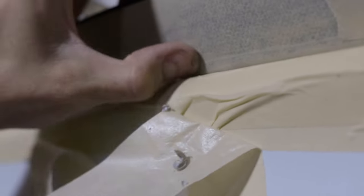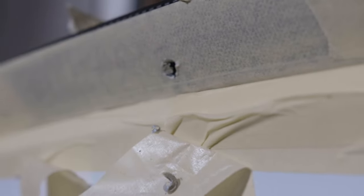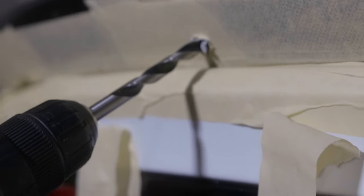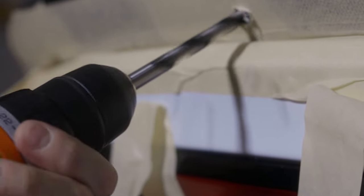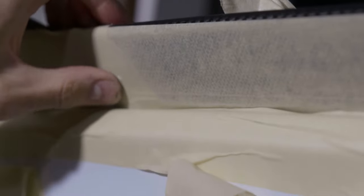There we go — first hole drilled. That was a little rough because my drill's power wasn't on full. Push nice and hard. You're going to want to make sure to tuck all this in — push it in. The rivnut will push in any of the vinyl or paint, so you don't have anything flaking out on you.